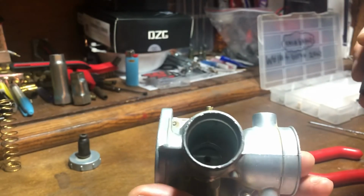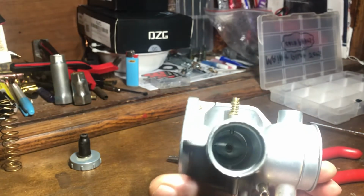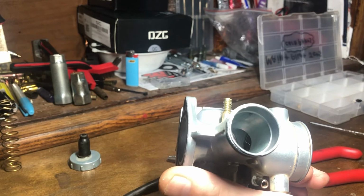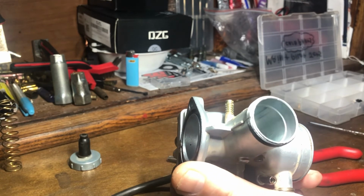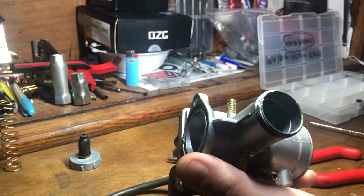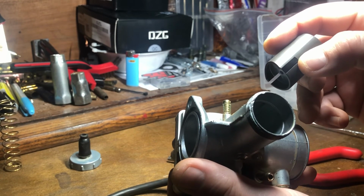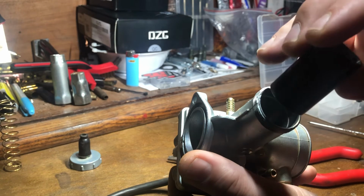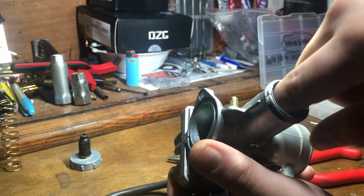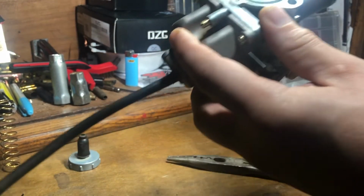From there, inside of the carburetor, I'm sorry, the lighting isn't that great. There's two notches, so on one side you'll see your idle mixture, your idle set screw. That ends up with the shorter side notch on your throttle slide barrel. Slide that in like so. It's seated, and then you'd go back to your bike.